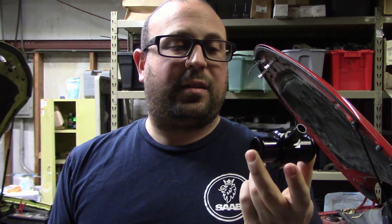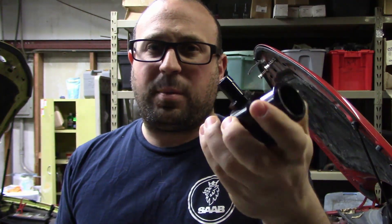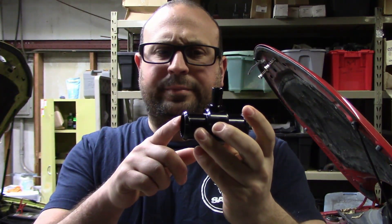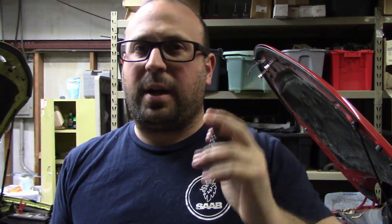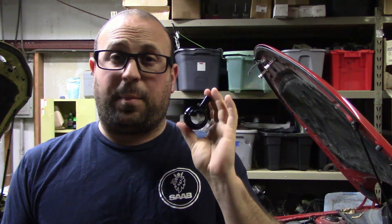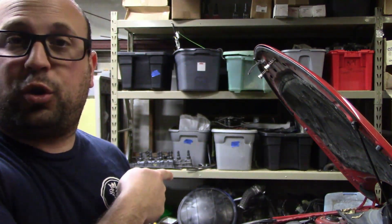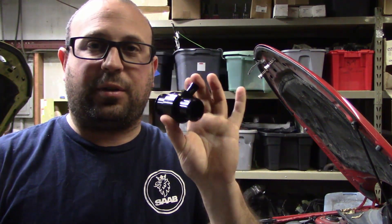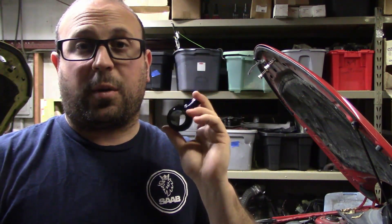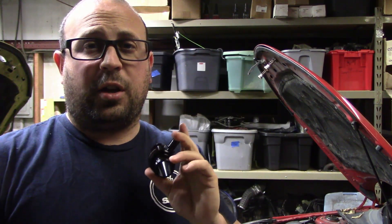It's a pretty well-machined piece of aluminum. It's a pretty simple part - it's just a Tee and this screws right in. It's really well made, nice and lightweight, significantly better than the plastic ones these cars normally have. We are actually going to replace the plastic one on my wife's 240,000 mile 2010 9-3. The car doesn't actually need one, but I want to try it out. Also, I am chasing a coolant leak on this car, so replacing this can't hurt.